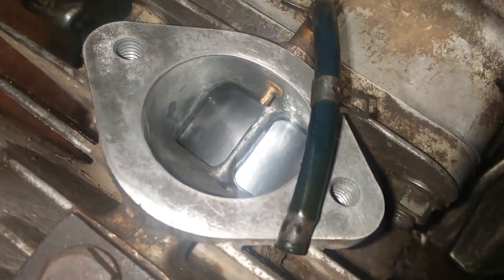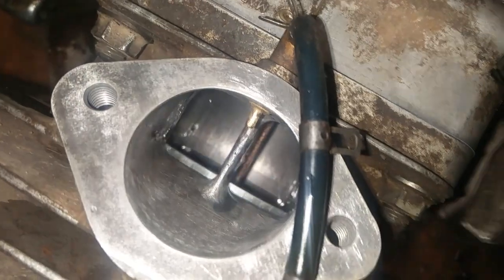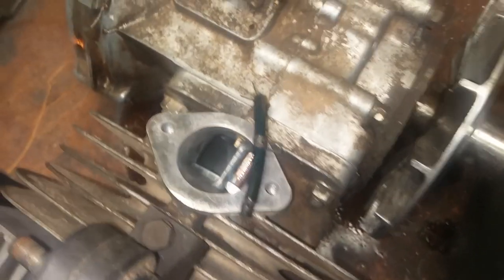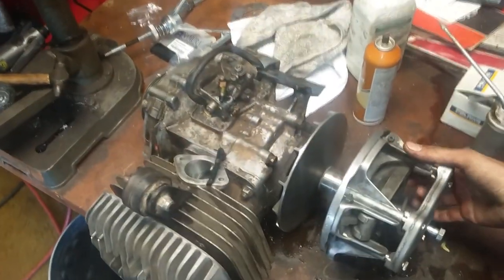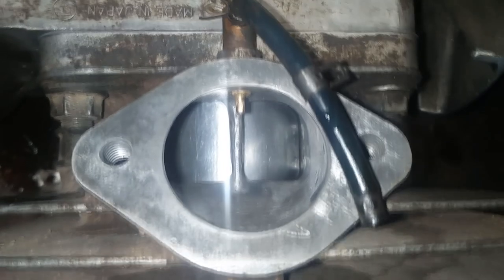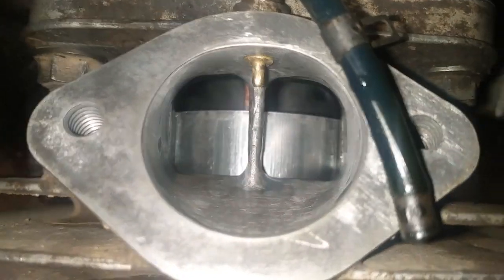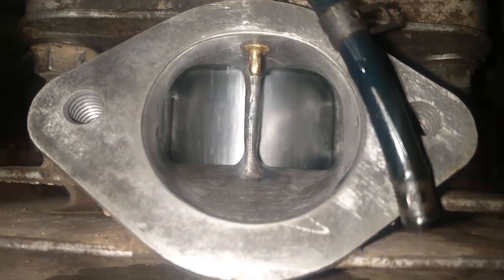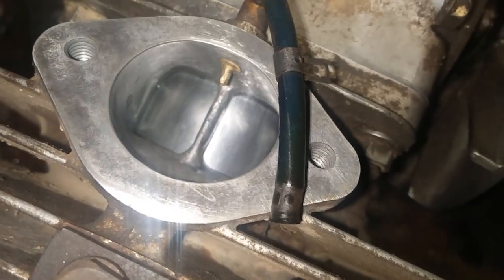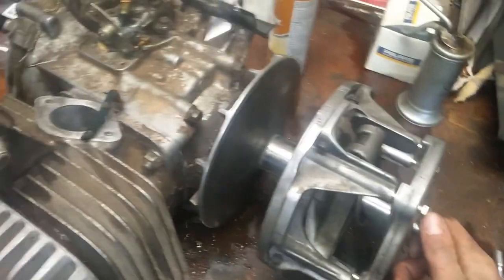She's bolted back together, looking mint. There's plenty of compression leakage, but the cylinder doesn't look too bad down there - there is a crosshatch on it. It even passes the rig-style compression check: put your thumb over it, it bounces back. Motor's good - rig style! Hopefully the rings will seat a little better. The compression's not awful, could definitely be better since the cylinder's pretty oily, but it's only gonna get so good with this pile. I'm not getting it bored.